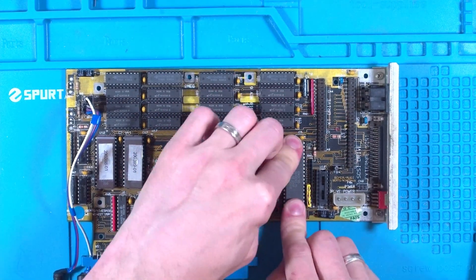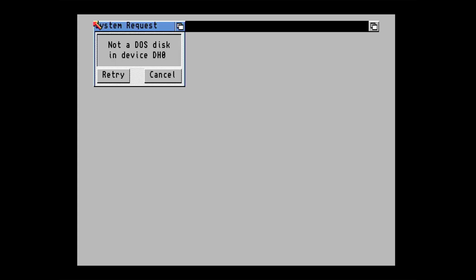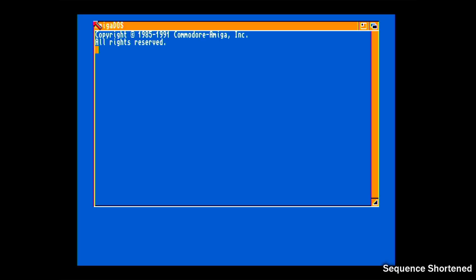Now as there seems to be some activity on the LED I thought I'd give autobooting a go. So I enabled the switch for autoboot on the back of the drive and turned on the Amiga. Turning it on it started to autoboot. Now this is interesting — it's finding the hard disk and attempting to boot from it, but something here is intermittent. First we get checksum errors. Then on reboot I'm getting a non-DOS disk warning. So I decided to boot from the workbench disk to see what's going on. There are some new disks but they're not at all readable. So I disabled the autoboot jumper and booted back into the A590 setup disk. And finally we have workbench but no disks. Weird.